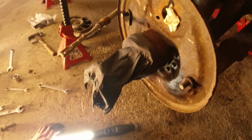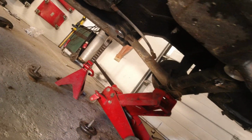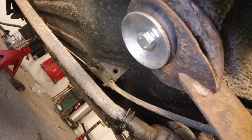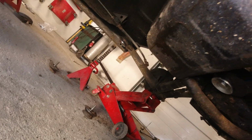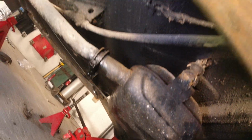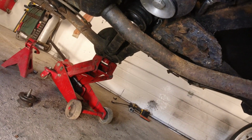This is it. Let me show you the progress we made today. We now got new suspension rubbers on all, and yeah, I know I call these wishbones because they have pretty much the shape of a wishbone, but it is not called a wishbone, it's a trailing arm. So sorry about that. But now it's all good. The bad thing about all this is taking all the old rubbers out made me realize that they were actually fine. I just changed them because they looked so cracked, and I know that would be an MOT fail, but actually it was caking from the undercarriage protection. But let's not talk more about that. Now it's all shiny and new, and that is cool.